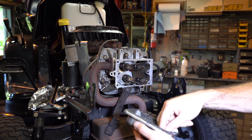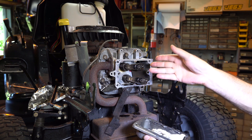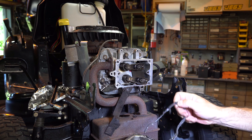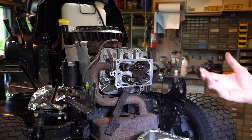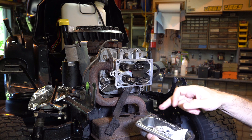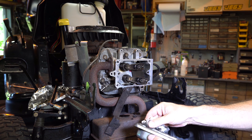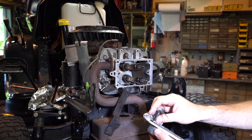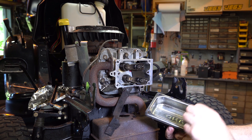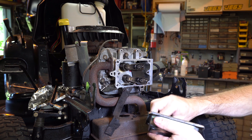Here's the mistake people make with these things: that gasket did nothing except go inside the motor, like the other one. So what we're going to do is clean this off, make sure it's flat and true. He over-tightened it, and by over-tightening you're pushing everything in where it doesn't need to be. The first step is to get all this gook off — clean it off good, no grease, no remnants, make sure it's flat and straight. Then I'm going to lay a bead down of high-temp red RTV.